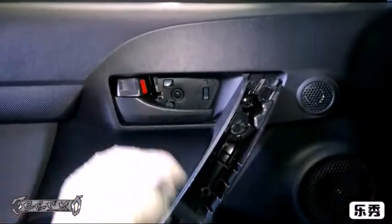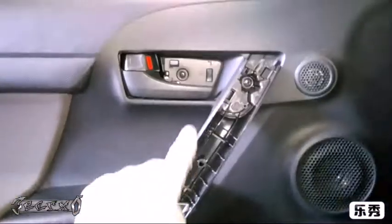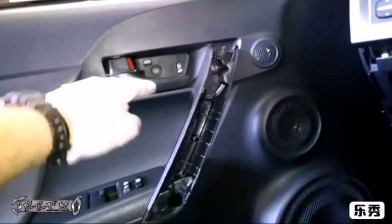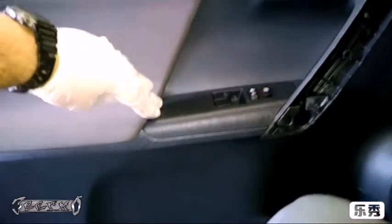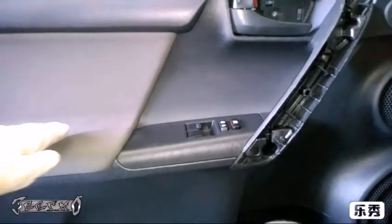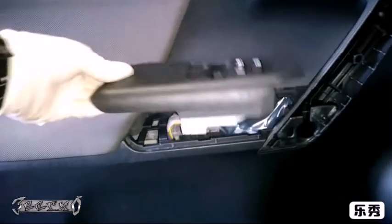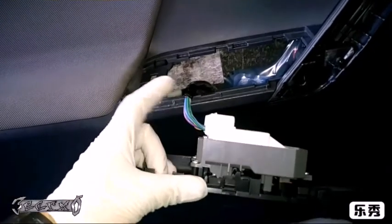Put that to the side. Now we've got a screw here, a screw here, and a screw here. I already unscrewed them so save these - put them in the cup holder, that's what I do. The two long ones are for the handle. Now put your pry bar right here and push up, then pull this out towards the back of the car. There's a tab in the front and we don't want to break that tab, so pull it up and then pull it backwards. If you try to just pull it straight up it'll break that tab and it'll sit loosely.